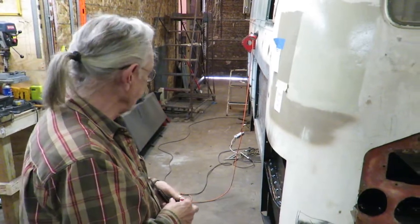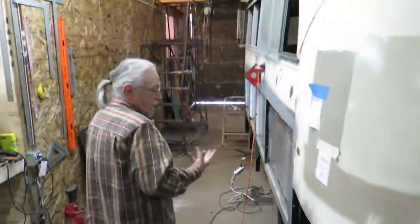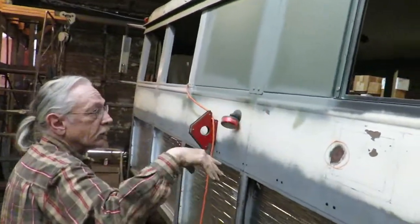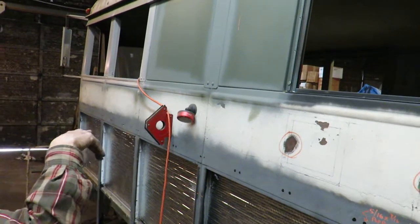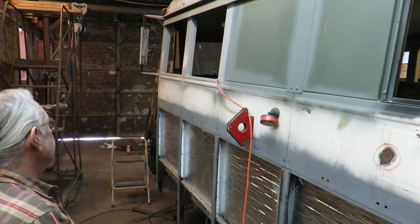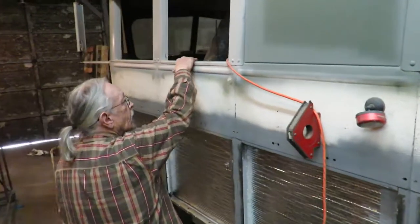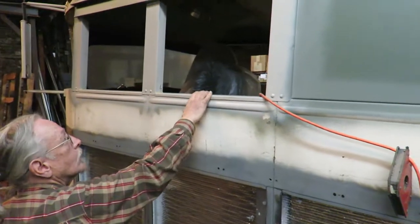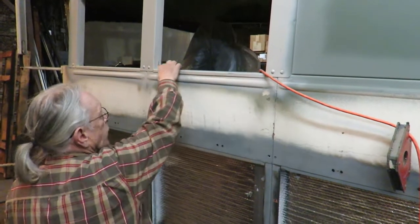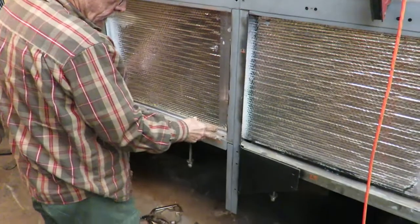Roof rack, like I said, all the body panels are fabricated and ready to go on. That'll be the last thing to go on. Window deletes are all 14 gauge steel. They're welded in place, sealed up with body seam sealer. Had to fabricate little closures for the tops of the windows. These old school windows used to open down into this wall, which meant these things were totally open, and rainwater just filled the inside of these panels.